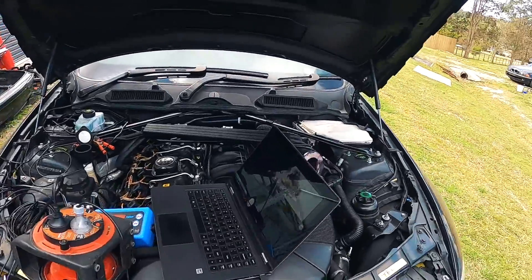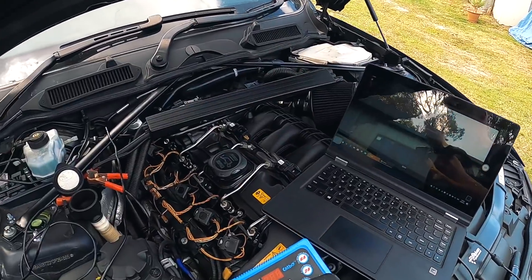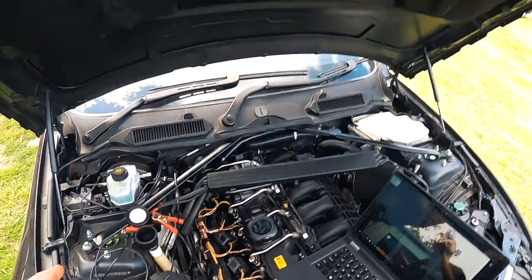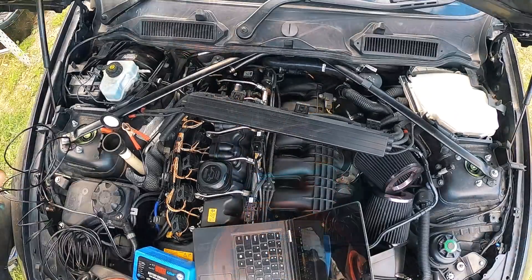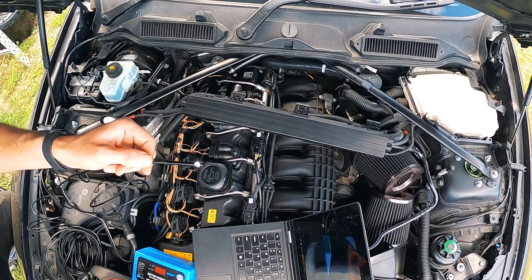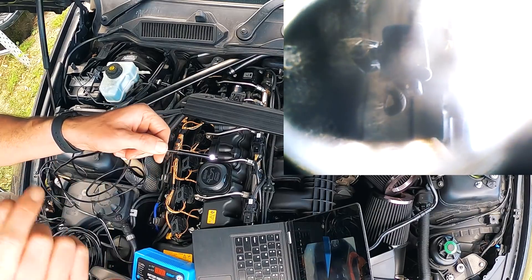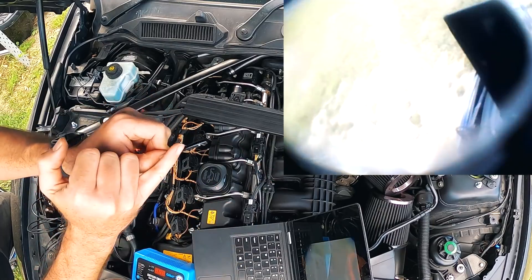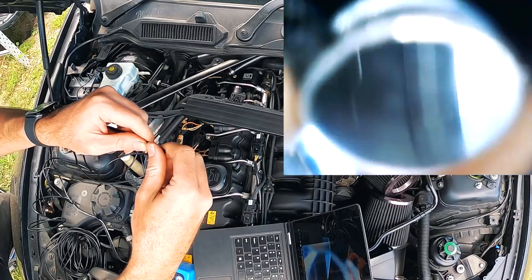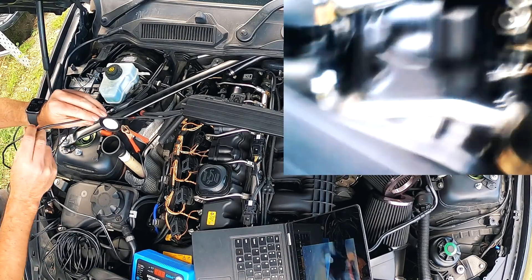I really want to get driving this thing again. I've got the laptop set up and I'm just plugging the boroscope in — I should be able to record the screen of what goes down. I've already got the spark plug out; that is the brown tip spark plug. All the other plugs that came out were white. I've got this little mirror attachment on there — I'm going to take that off because I want to have a look at the piston first. The mirror gives it a 90-degree vision. Let's go down into the cylinder.